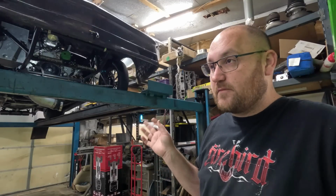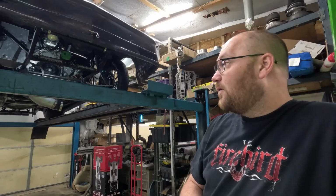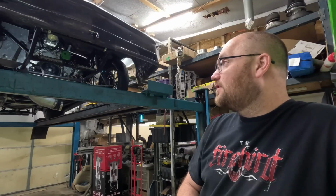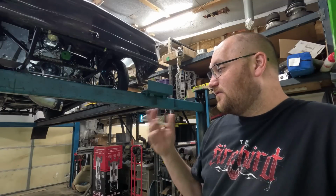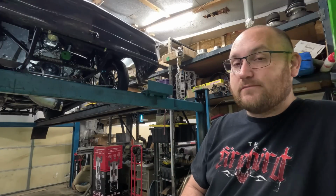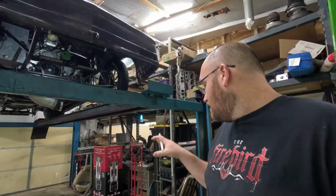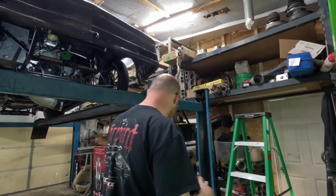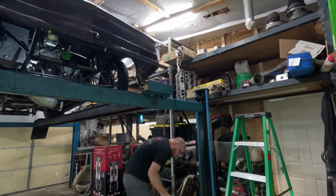Ideally, I probably need to do a custom crankshaft with a big block snout and then do a bunch of other stuff. Or I wish ProCharger integrated a crankshaft support bracket or crankshaft support system into more of the bracket kits. I think that'd be cool. So that, or make a new ProCharger bracket, because it's just a single plate of, I don't know how thick that is. It's either 5/8 or 3/4. See how thick this thing is. Yeah, it's about 3/4 of an inch thick.